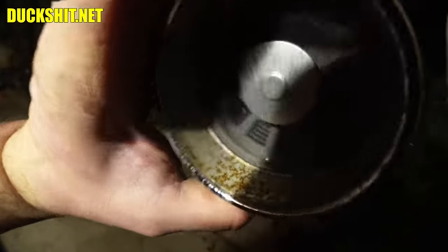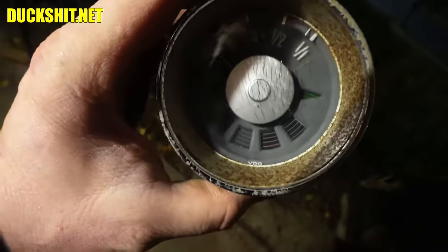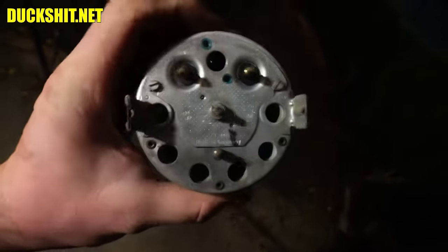I hope the gas gauge still works. There were three little watch screws that go underneath one of the little bezels inside of there — you can't see them. All three of the screws came out, so I put them all in and put a little dot of hot glue on top of them to try to hold them in place to stop that from ever happening again. What a nuisance — even the screws were semi-magnetic, so they were practically impossible to get to lay in position properly and thread them in. But anyway, gauge is back together. This is what a Type 3 gauge looks like — there's a plastic socket that goes over the back of this that the gauge plugs into, which has all the wire hookups and all the bulbs in it.